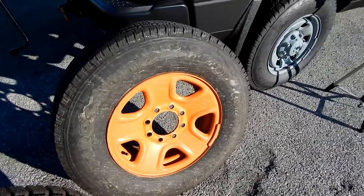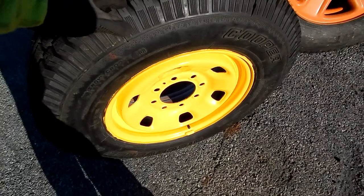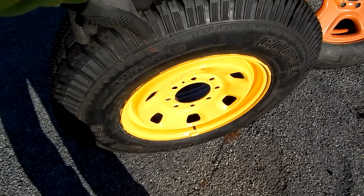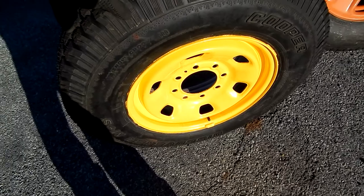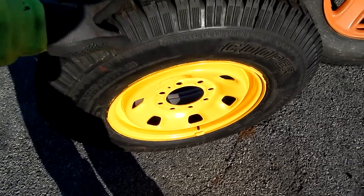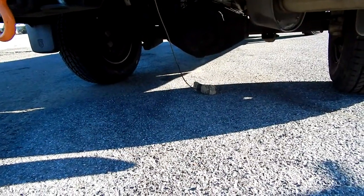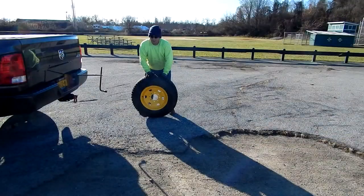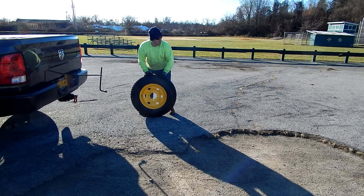I was able to find a bi-directional winter tire that I could use with these, so that's why I got this particular tire. Obviously it's been under the truck so it's a bit dirty. For my all-season spare — the 275/70R18 — I painted it gloss orange. I make them high-vis to show they're spare tires. This was supposed to be safety green, but Rust-Oleum has been having problems with their spray paint lately — the can conked out mid-job. I was really pissed, so I just used brush paint to get it done and out of my garage. I also want to show a trick so you don't kill your back with these tires: first, wind your cable all the way down and throw it toward the front of the truck.